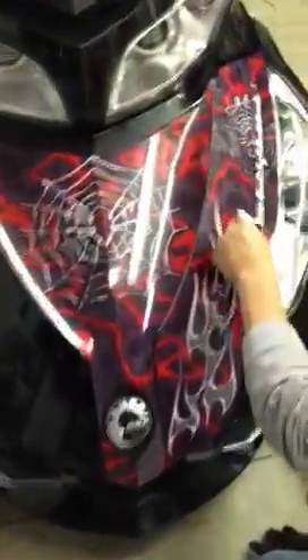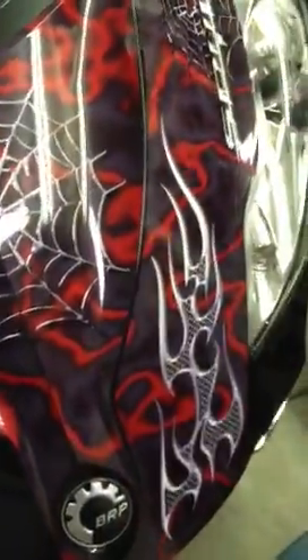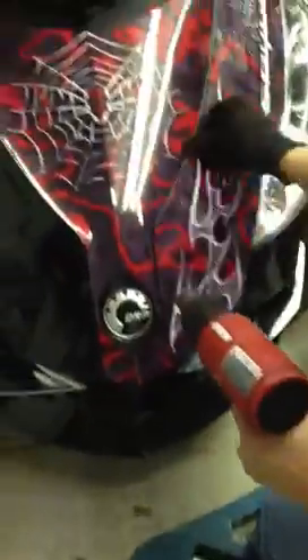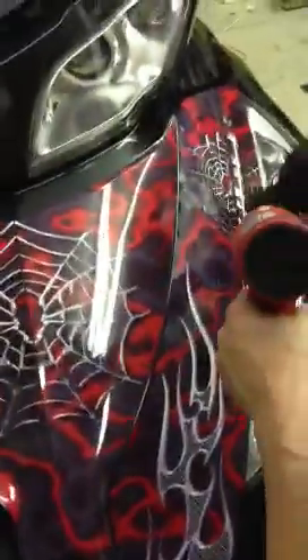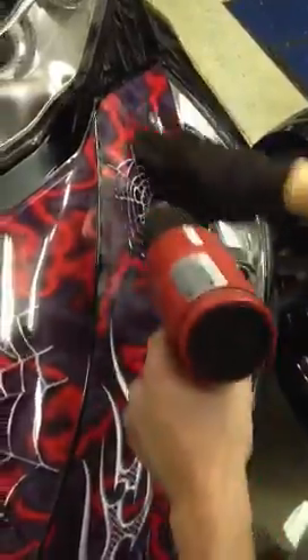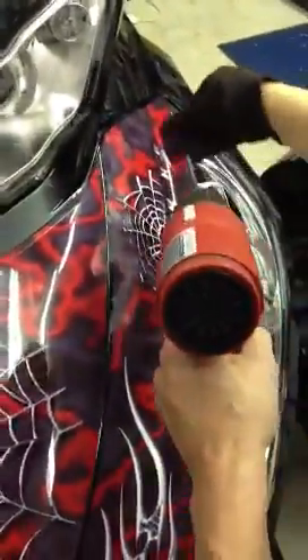The outside piece is installed. As you can see, not a big deal — let the material fall. The easier it falls without you stretching and pulling on it, the easier the application will be. Once you get it on, just like with the centers, you're going to go back over everything with heat. That sets the film to take its permanent bond, which ensures that you won't have any lifting or peeling down the road. You can do several applications of heat going over the surface, rubbing it down with cotton gloves or a soft towel.